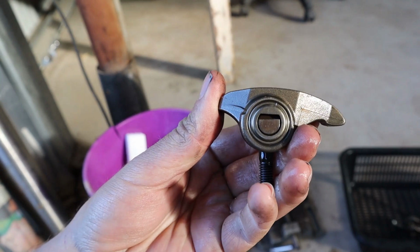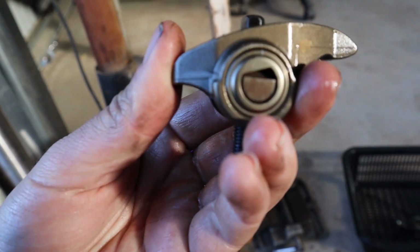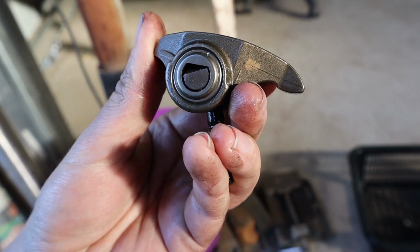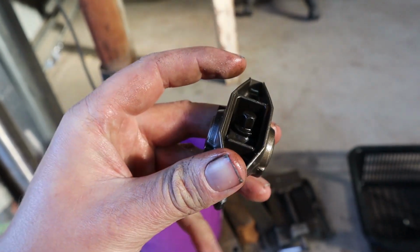Not only that, but you can see here the stock trunnions are a lift limited trunnion. You can see there where they start to contact, there's only so much lift you can get with the stock trunnion. The new ones eliminate that. The new ones will spin all the way around if you want to. They are what we call no lift limiting. Now, there are a heap of trunnion upgrades available on the market. You will notice that both the ones that we offer are what we call an oil impregnated bronze bush, or a completely solid bush. They're not actually brass as much as people call them brass. They're not, but they're a solid bush. They completely eliminate the needle rollers.